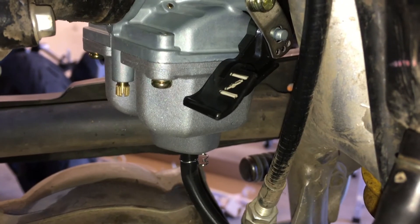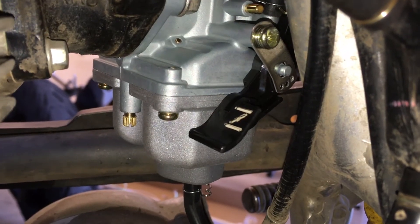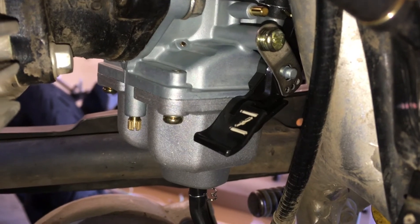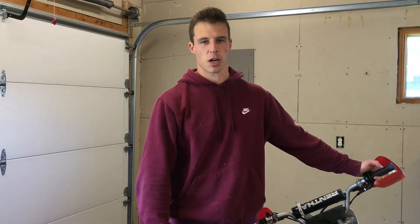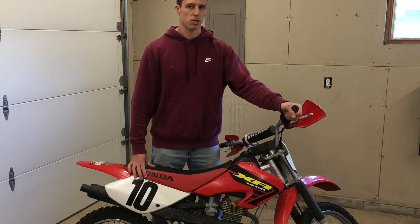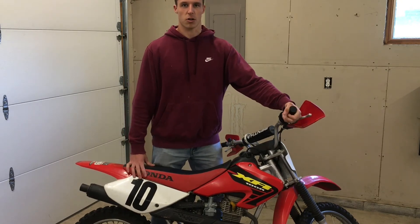I think some of that might just be due to the design of the engine. If anybody's got a solution to that hesitation problem when you really roll on the throttle quickly, let us know in the comments below. Also make sure your idle speed is set correctly — around 1400 RPM. If your idle is set too low, that can really accentuate that problem. But that mid-range bog issue is gone, so let's take this for a ride and see how it runs.